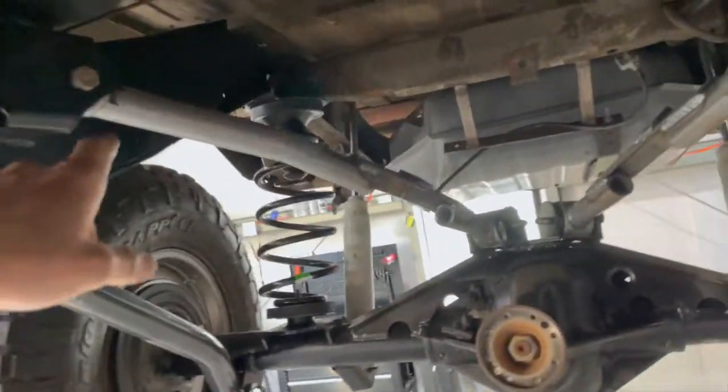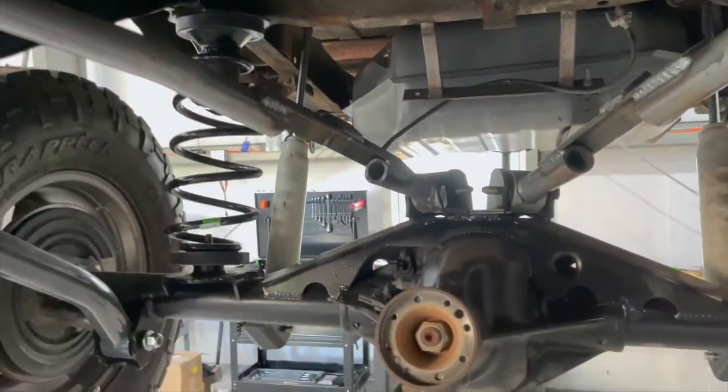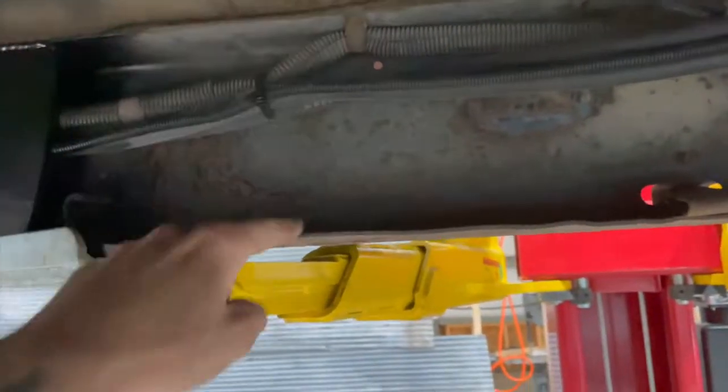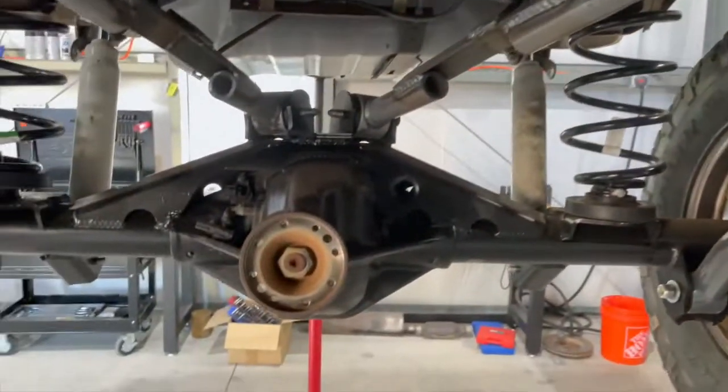The rear is my little DIY kit right now because I'm waiting on some control arms I ordered, so I just needed something to get them mocked up. I had some Rubicon Express arms off a JK at the shop that I cut, extended, and made a sick gusset that will get my links right. It's a C-channel frame, and I'm going to put some tube that welds on this side and welds on the outside — two more over here — so it helps actually box the frame a little bit more. I'll drill some holes, run some tube through it to help with torsional twisting, and this plate will help hold the Artec bracket to the JK rear axle.